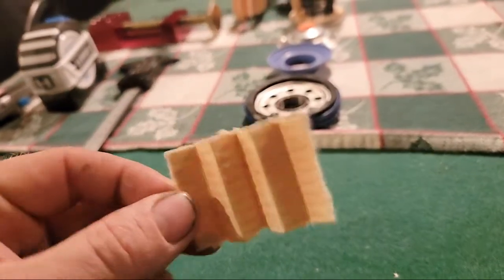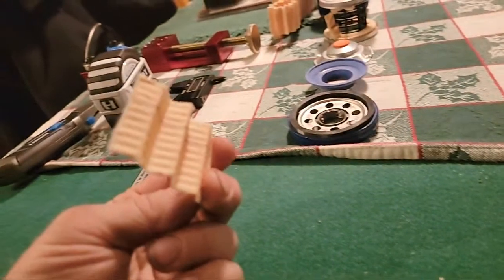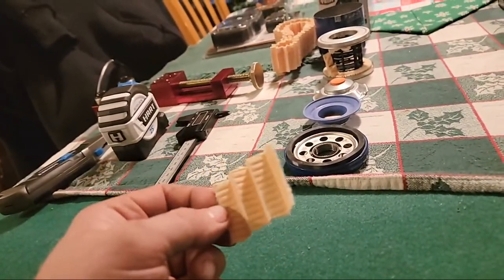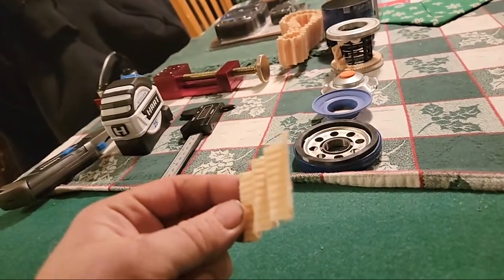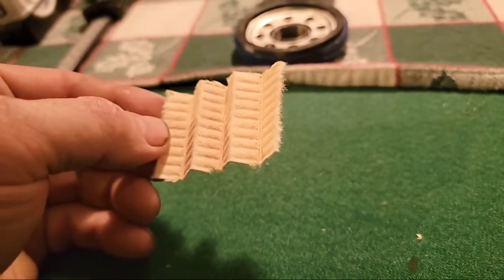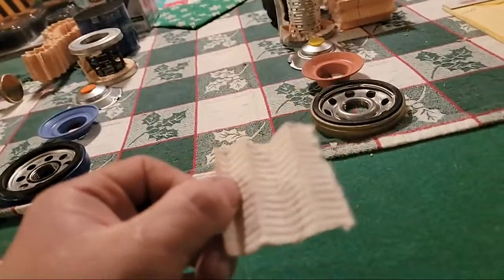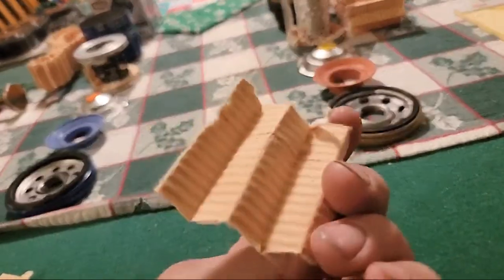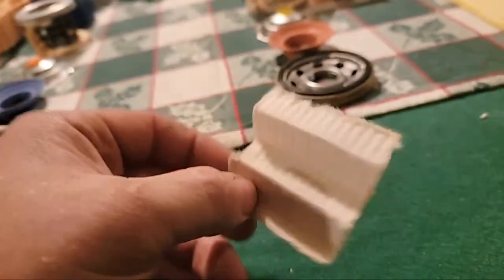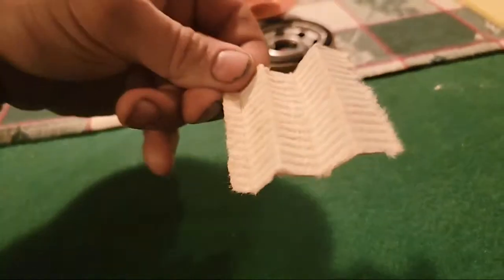This is the filter that's in the Supertech. Just your basic, maybe a little bit higher grade, thicker cellulose filter. This pleat is 0.8 millimeters thick. This pleat here is a synthetic and cellulose compound mix. You can see on one side, it's got the cellulose type, and on the other side, it's got the synthetic type material, that nano type material that they would use.